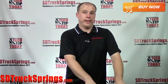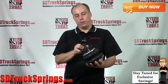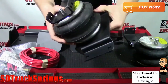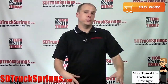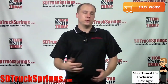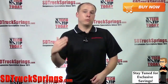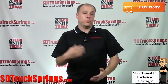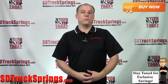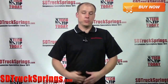After you read the instructions you want to pre-assemble your airbags. You're going to want to bolt in your upper bracket and bolt in your lower bracket. Before you start installing this kit, make sure your vehicle is on a flat level surface and remove the negative battery cable. You will then raise your vehicle by the axle and remove your rear wheels. Many customers also prefer to remove the spare tire to give more room. You're going to need a hacksaw to cut off the jounce bumper from your vehicle.